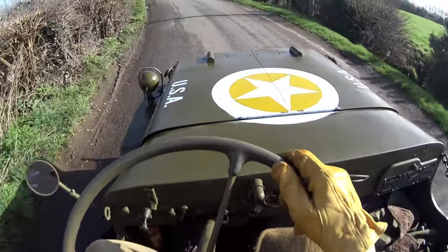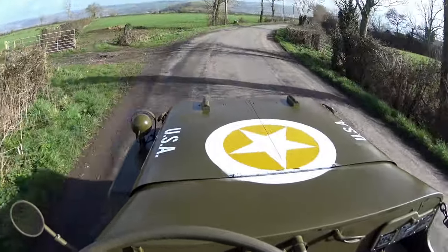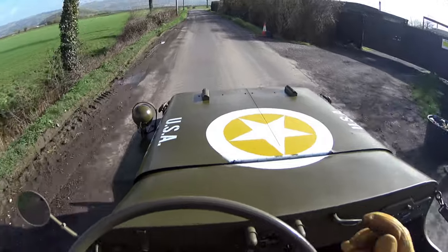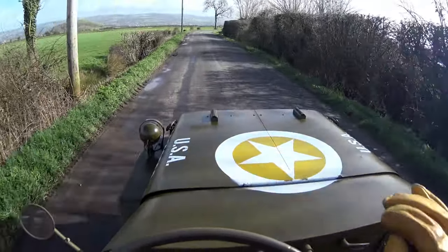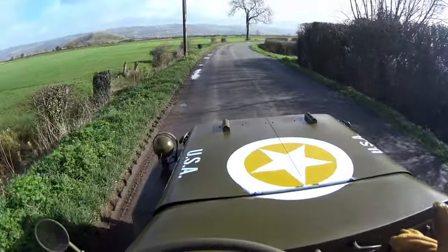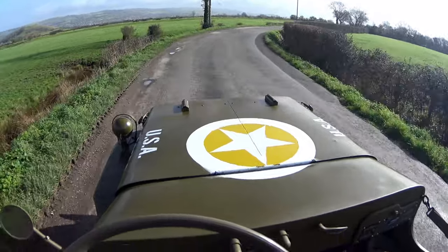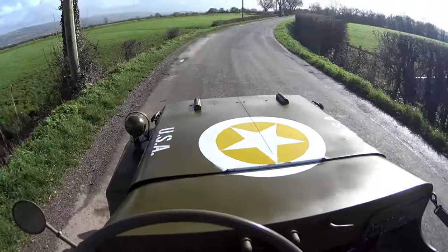Can you notice any difference? Because I can't. Obviously it's got a little bit less power than the WO and the big-boy Solex with the pump, but otherwise you can't notice anything. There it is — that was in second gear and I really mashed down the throttle, so obviously the accelerator pump does have a little bit of use in a specific regime: second gear, low speed, sudden full throttle. The accelerator pump would help there. So we found where it matters.